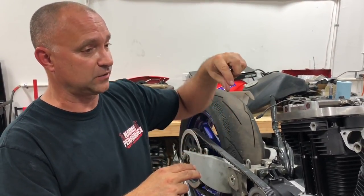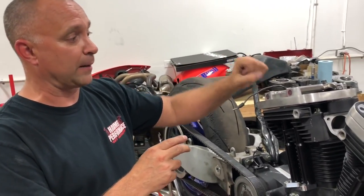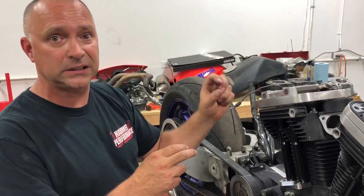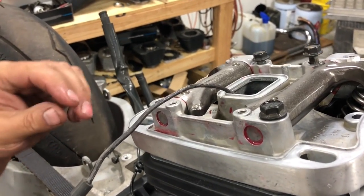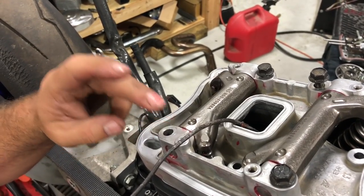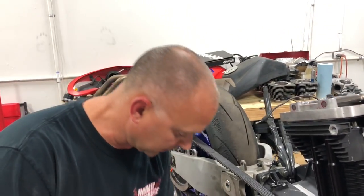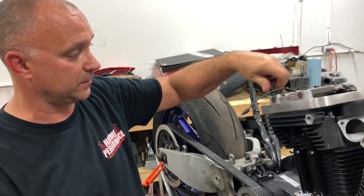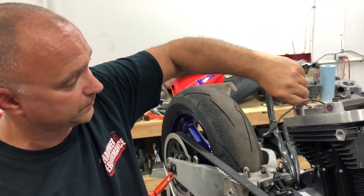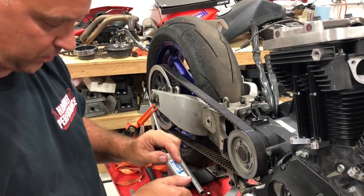That shaft rotates, and it can only rotate so far until it hits that bolt. It hits the bolt, then goes back up and hits the bolt the other way and stops. So the shaft is getting grabbed by the rocker arm and rotating. You get a ting, ting, ting sound, and it's that shaft smacking that bolt. They do make rocker lockers. That is a piece that I believe goes in the bolt area there to keep that shaft from spinning, which alleviates that noise. So that's something to consider: take a look at your bolts, and if you see the smiley faces on there, then you know the shaft is hitting the bolt. That's something to keep an eye on. If you think you have a noise in the top of the rocker box that you can't decipher, that's one possibility.